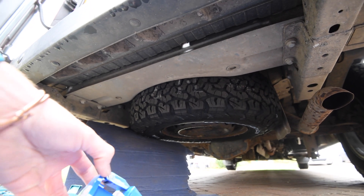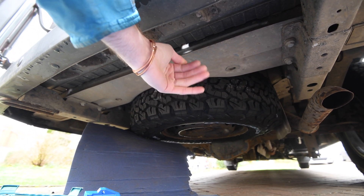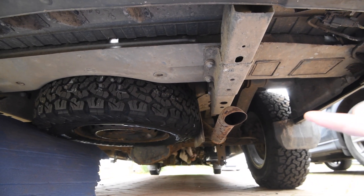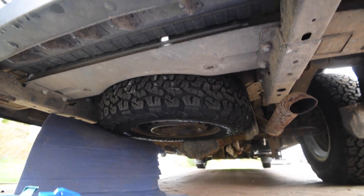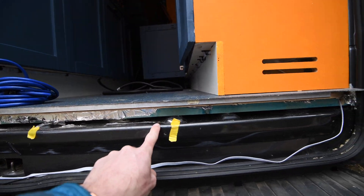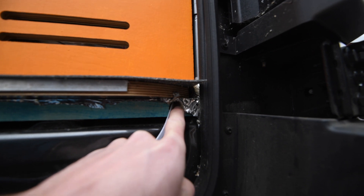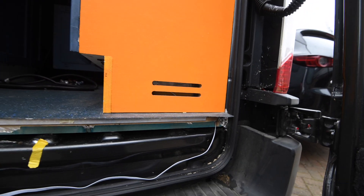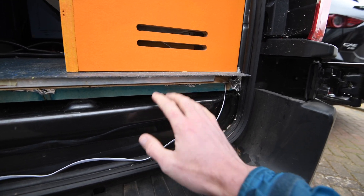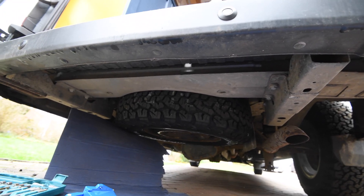So, position of hookup — I'm going to put it probably about here. The reason I'm going to put it there is: one, it's blocked from road debris by the tyre being in the way, and there is an access hole. That links to this pillar here — this whole cavity is empty and that whole cavity translates to this bit of the bodywork here. So effectively the wire is going to run up in there and then come out of a hole here. I'll put a gland to protect the cut wire from chafing on the metal, and then up through my little access hatch which goes into the electrical cupboard. It's similar for the chassis earth point — I'm going to have the inverter chassis point come out of this hole and mount somewhere I can directly see and check in the future to make sure it's always got a good contact.